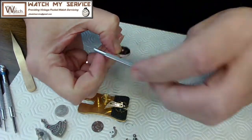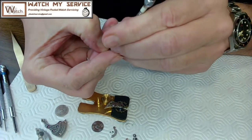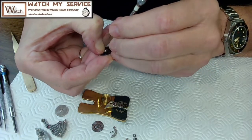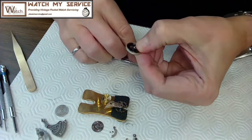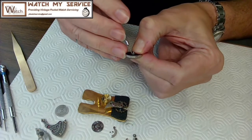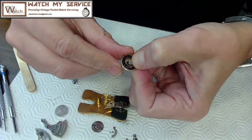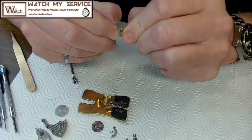And I just need to use a screwdriver on the other side to get in here. And then play the old widen the spring game, I like to call it. Widen the spring. All right, it's good on that side. Now on this side here, I'm going to widen it, just put the screwdriver in here, like this, and then get this above that. And you see that? That's sort of almost in right now. And I'm looking at the bottom, and there we go.